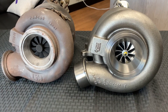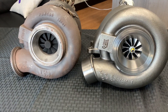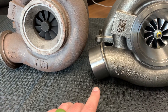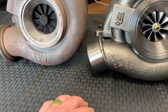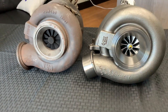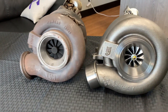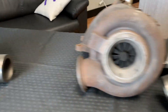What really stands in the way between you bolting an SDP high pressure turbo onto your older ACERT truck is this compressor discharge flange — basically where it goes up into the pre-cooler. You can see that you have a V-band versus a slip joint. You might say, 'why don't you just switch the compressor covers?' — but don't forget, this is a 62 millimeter inducer versus a 70 millimeter inducer, so you can't just switch the covers.